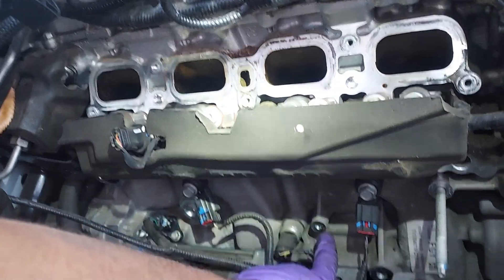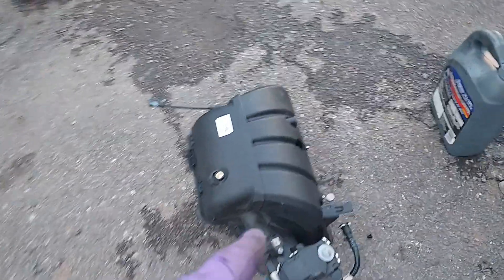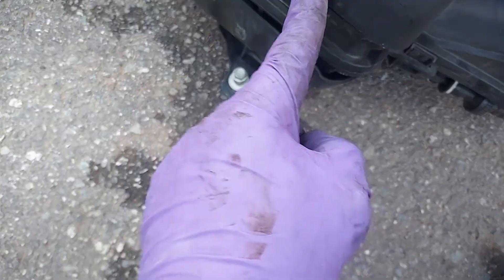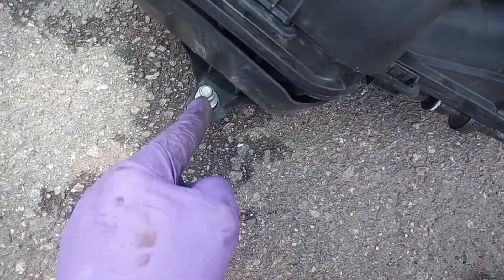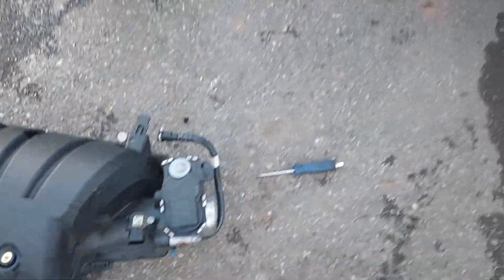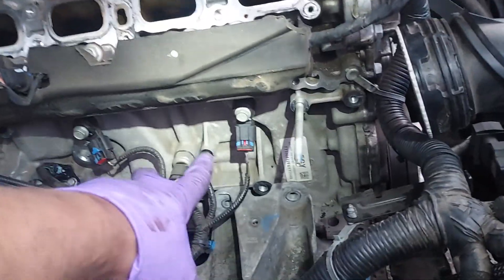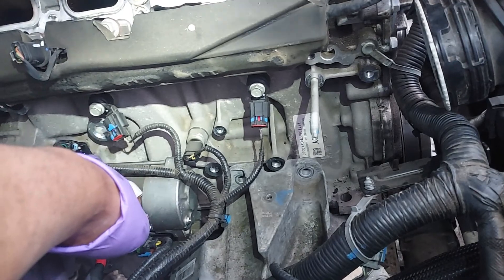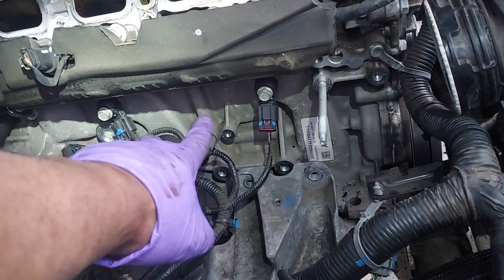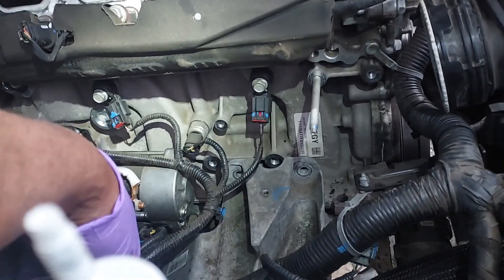By taking this intake manifold up from the top — five bolts plus one more bolt right down here — just aim a little bit to the left side and you can get to your bolt. These are all 10 millimeter bolts holding them in place. Your knock sensors are right here — both knock sensors — and your crank sensor. You can get them all from the dealership and do it all in one shot, because if one sensor goes bad, you're back to doing this big job again.